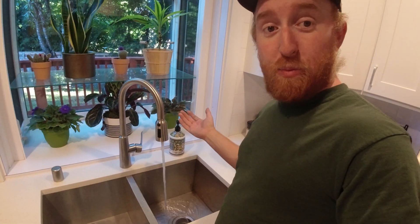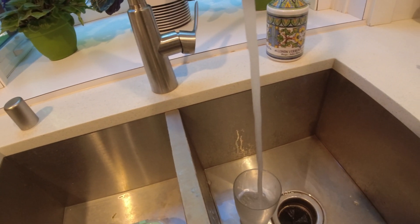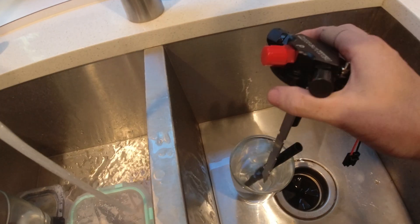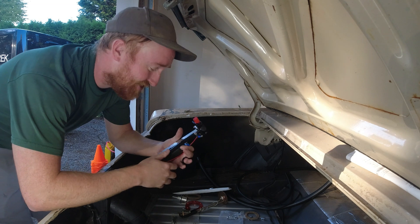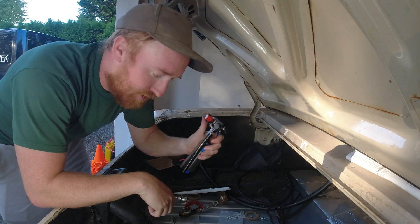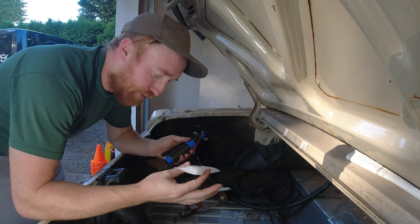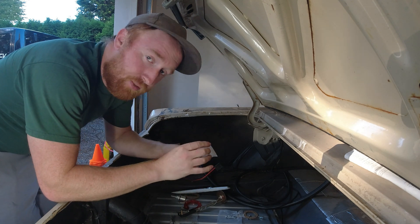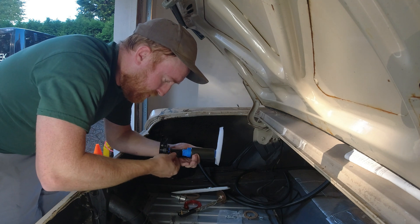So now in the kitchen, I'm just heating up some water. Luckily our hot water is very hot because my wife likes super hot showers. I'm going to use one of the old cloudy glasses, fill it up with super hot water, and stick the hoses down into it. That heats up the specific hoses so I can slide the fuel pump down onto the actual hoses themselves. After a lot of finagling and a lot of hot water, I got the pump on with the hose clamped up and ready to go. I also got the little filter bag, which slips right onto the end — that's the filter inside the actual tank itself — and this clips right on in here.